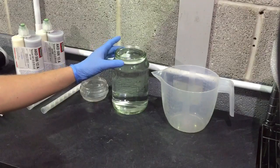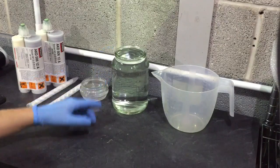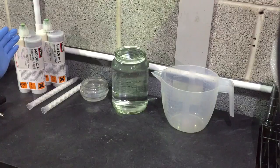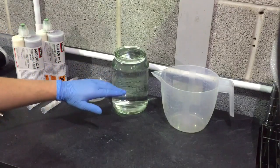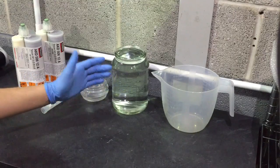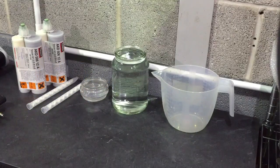We're going to empty this water out now. We know this jar is 1,600 millilitres. Obviously the halfway mark is going to be 800, so if we inject this in and get no expansion whatsoever, we'd see the foam at about halfway. If it stays there, there's no expansion. We're using a glass jar mainly for transparency — when it goes into a rear axle carrier panel, you don't see how it expands, how it moves, or how fast it expands.